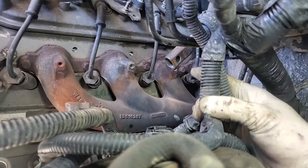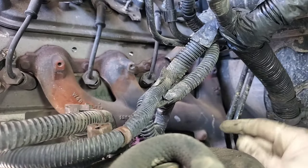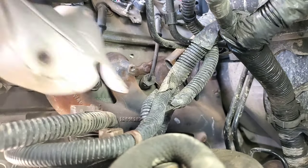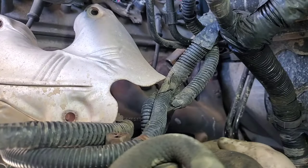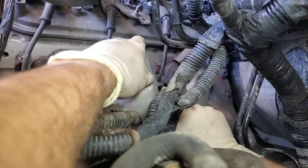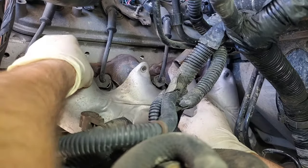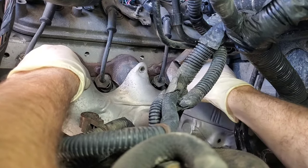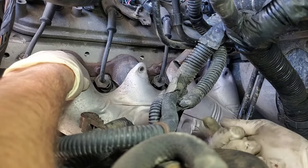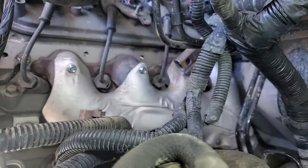Let's go ahead and move on to the exhaust heat shield. Get these wires out of the way to show you — four on top and there's the one on the bottom. Slide this heat shield down in here — easier to go from the top. I ended up grabbing two new bolts because I lost one somewhere along the way, so three old and two new. Once you get her into position, slide these in finger tight again — everything's finger tight at first. Then tighten them all down. Chrome ones up front — everyone knows shiny adds speed.